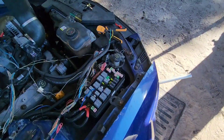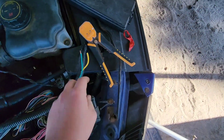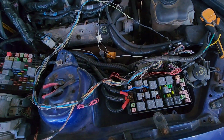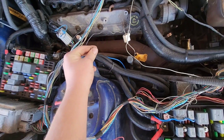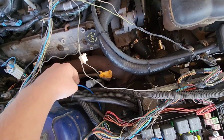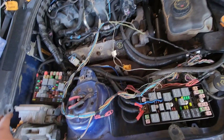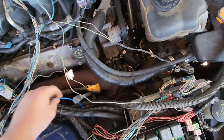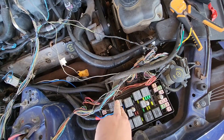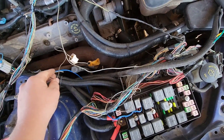This is where our wiring comes from the back. Green is our fuel pump trigger. Over on this side, this is our fuel pump trigger coming out of the factory Chevy fuse panel. This blue wire is our key-on power that energizes the entire Chevy ECM and fuse panel — I just have it shoved in a Ford fuse right now; that's getting taken out and permanently attached to a keyed source. This brown is our oil pressure switch to make the Ford oil pressure gauge work.